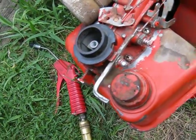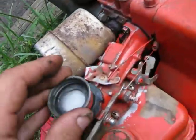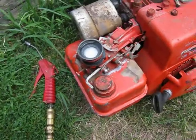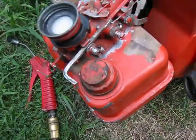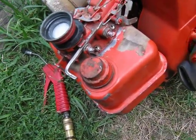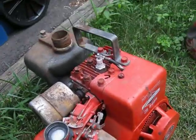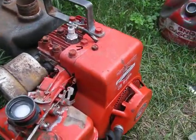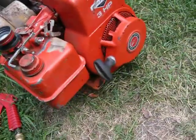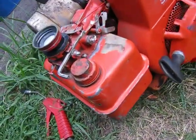That's why I was able to run it with the gas can lid creating a nice perfect seal on there, and put my hand over the three vent holes on the gas tank. It just needs a base gasket — otherwise the thing runs great. It is difficult to get started though; you have to use starting fluid only because of the gasket problem.